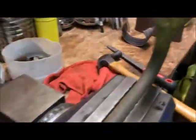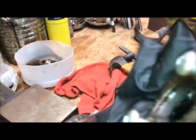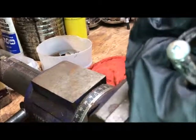Here's what's left of it after I pulled it out. I used 2 screws, and I used this little crowbar I have here. I think Clint Lazion gave me that crowbar. It comes in handy. It's a small one. But yeah, I drilled 2 holes, put 2 sheet metal screws in it, and then used this crowbar to work this seal on out. It's maybe a half inch thick, but it's not a cheap little seal either.